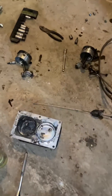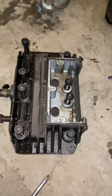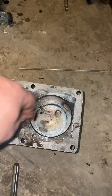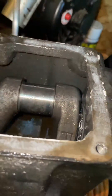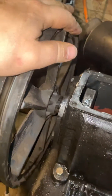Now I just got to get that crankshaft off. To take this apart was about 10 minutes. First thing I took off was the air filter right here and the top piece — a couple of air lines go there. Then next came the block; the pistons were inside there — just six bolts, and that's how we got down to there. Took the pistons out, two bolts on each side, marked them so they go back into the same spot.